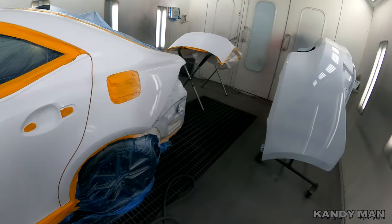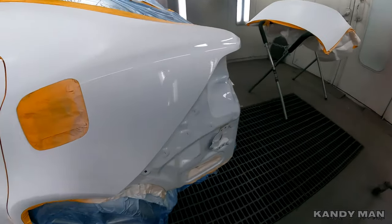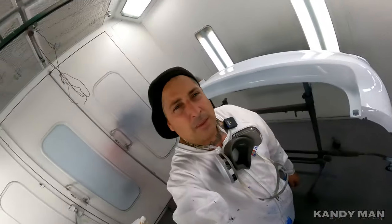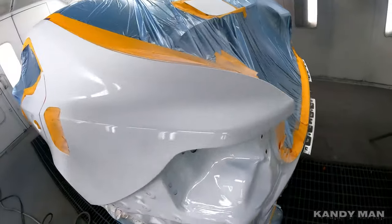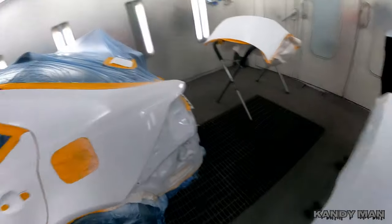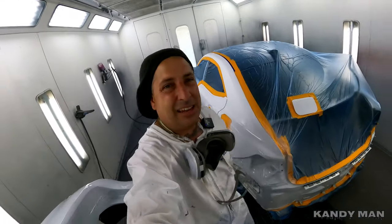We got it sealed — white sealer on it, and it looks fine now that it's all sealed. At the end of the night when I mix up primer I mix up one big batch and hit all the cars — I don't have time to go around mixing colors because I seal everything anyway. I like using the darker sealers because it lets you see what you're doing more with that shiny primer from Sherwin. So let's go ahead and get our base on, pearl it, clear this thing, and get out of this heat.